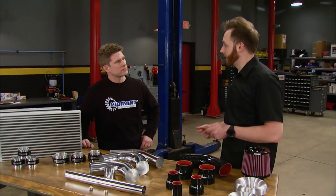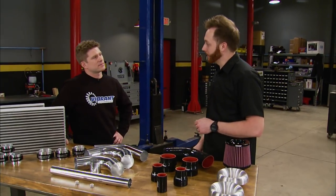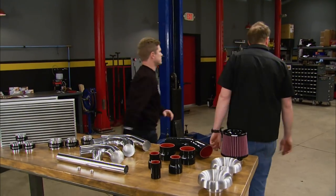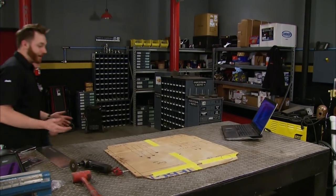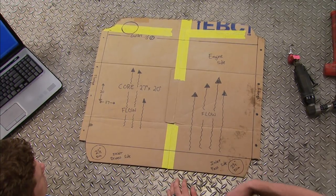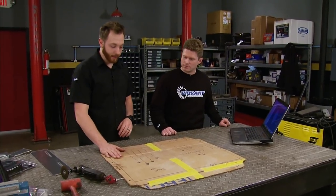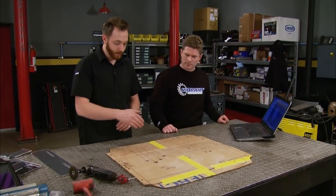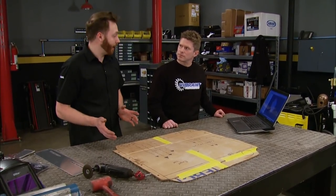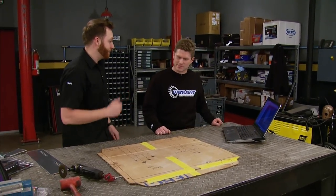A couple weeks ago I sent you some drawings and templates of what I thought might work for the F100. So let's take a look at how we're going to translate that pattern into a real-world intercooler. We've got our template here — this is kind of what I figured out for how it would fit best in the truck. We've got a couple of inlets on the bottom; the air is going to flow up through the intercooler and exit on the top. One way we could have built this is to start with the template, get the intercooler cores and cut some aluminum — maybe use a cardboard template. It would have taken a while, but we definitely could have made an intercooler. But since we have you and your expertise here, how would you do it?